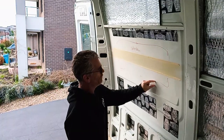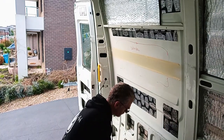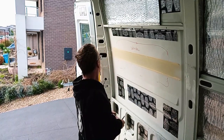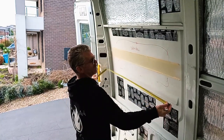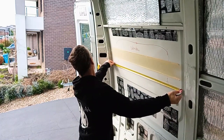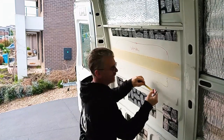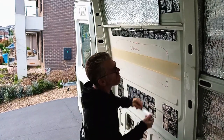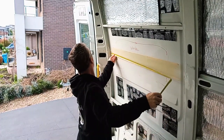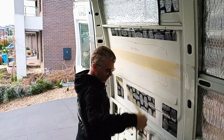So I'm going 50mm above the crease in the van there. These windows in the rear are a metre wide. I'm going to make it even on the panel — 90mm, so I'm going to get 45mm in from each end. Check my overall length: one metre.